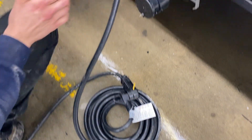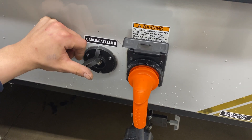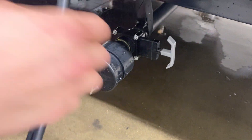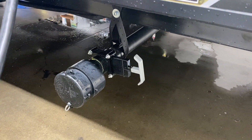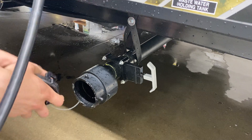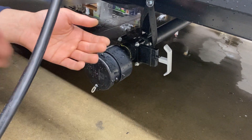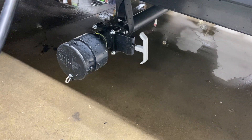Right beside it we've got a cable and satellite inlet — a coax cable will plug in there and fire up at your TV location. Right underneath that we've got the sewer connection for your gray tank. The gray valve indicates the gray tank, which is filled from your sinks as well as your shower. When it comes to dumping, pop this cap off — you can see the two ears and how it attaches; your sewer hose attaches the same way, pressing on and turning into place. When you're ready to dump, pull that valve out allowing the tank to drain.